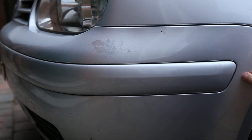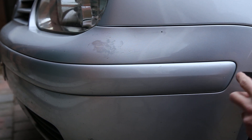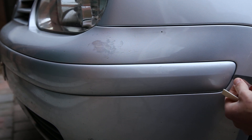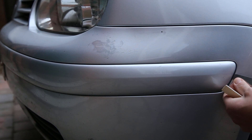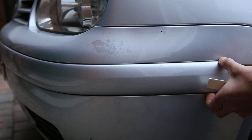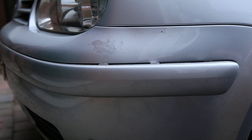In order to remove the inset bumper trim you need a sharp edge, so it can be something like a screwdriver or a knife, or something that's a bit flatter, and gradually just prise it off. It just unclips, and literally that's it.